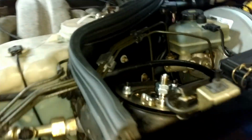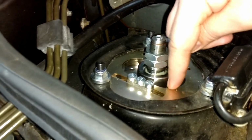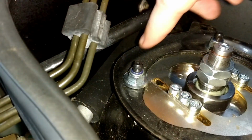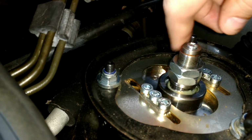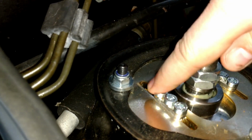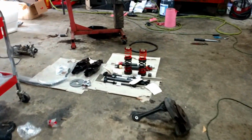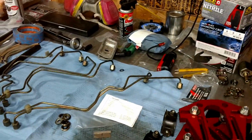So here we go. That's the bolt-in camber plate into the strut tower. It's 3 Allen bolts with some nylock nuts, and you adjust these and you can move the camber. But I had to wait on these round plates that bolt right up into the factory location, because what originally came, here we go, these were the camber plates.